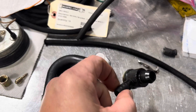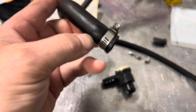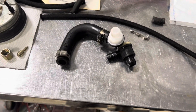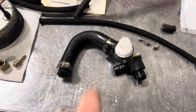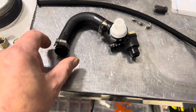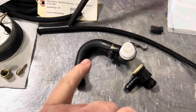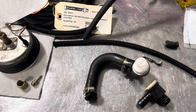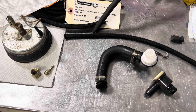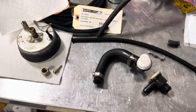We've got the original check valve out of the car — which sounds easy when you say it fast. Look at the dry rot, the bulging, and the cracks starting. We're definitely going to replace that hose. That is a Porsche-only part — you probably could loop something up, but they do consider it a molded hose. If this fails or if the one under the pedal box fails, the car will still stop. You're just going to have to treat it like a pre-'76 car and use a lot of foot pressure. Not worried about that for a short test drive to prove this works. All of these old hoses — we're getting to a point where the whole car needs to be replaced... just kidding.